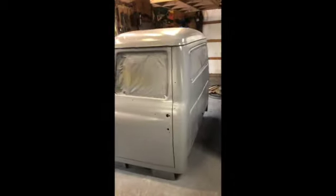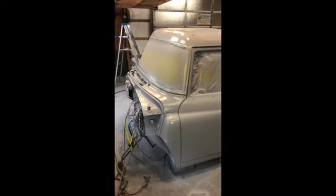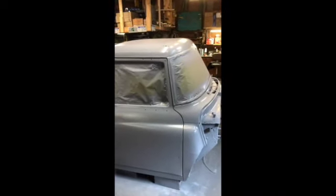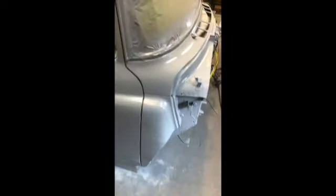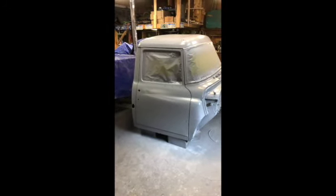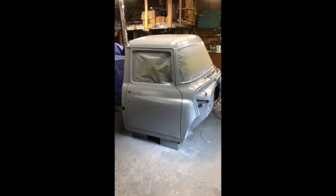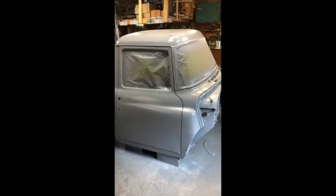The primer sealer is complete. I probably should not have listened to the tech sheet that told me to put just one heavy coat, because that first coat sagged pretty bad in a few spots — mostly on the curves. The flat profiles were okay but the little nub profiles on both sides and all along the roof line sagged. Luckily it's primer and I had plenty of it. I let that coat flash over, wet sanded it with 600 where it had sagged, wiped it back down, and this is three to four coats on top of that — so some spots have five coats basically.